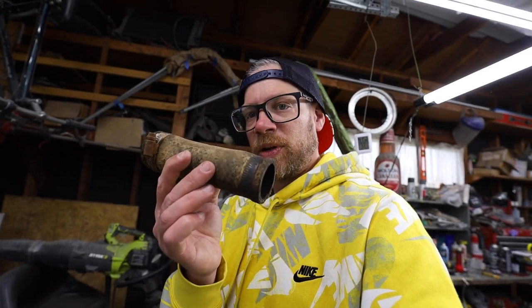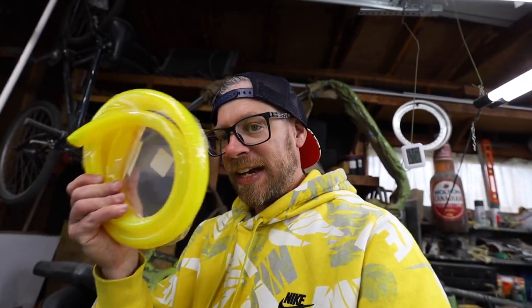I bought a new fuel filler-to-tank hose and some vent tubing from McMaster-Carr. The filler neck I got from Filler Neck Supply — it's 1-5/8 inch or 41 millimeter, the same size I used on my Rabbit. You have to buy a 12-foot length but it's only about 20 bucks. I can link it or give you the part number if you reach out.